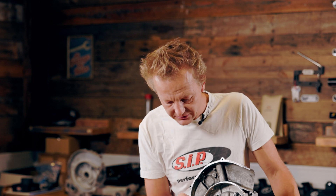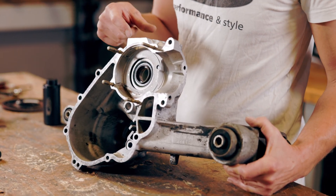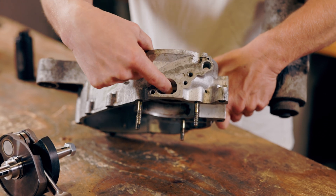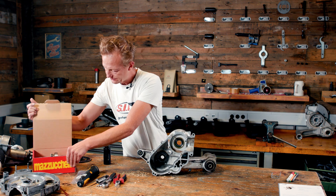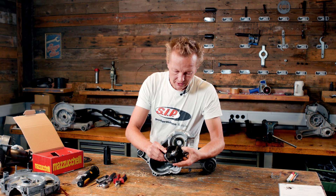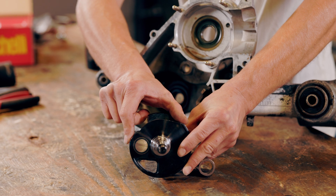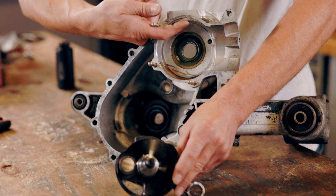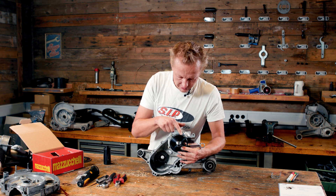The reed valve is self-adapting to the pressure or the vacuum below the piston. But here I prepared a standard Piaggio Vespa crankcase, which shows the significant rotary valve intake. Here is the air coming from the carburetor and the crankshaft web. The crankshaft web has a cutted section — within this section the intake port is open and the gas can flow. If the crankshaft is on the position where the crankshaft web is full, the intake is closed.